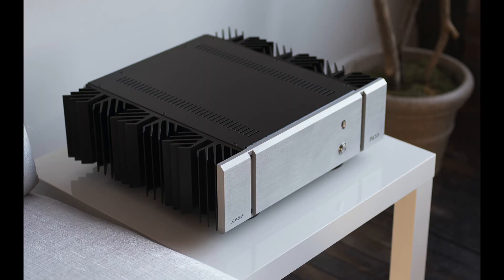At this point I decided to compare the Arioso to my Pass Labs XA25. The first thing I noticed was that the solid-state combination was warmer — just tonally warmer overall — and less alive. The bass had more low-end drive, more punch; it just kicked harder through those 15-inch woofers on the Cornwall 4s. Comparing 25 solid-state watts — which go down to 50 watts at four ohms — it definitely feels more potent and more powerful than eight watts.